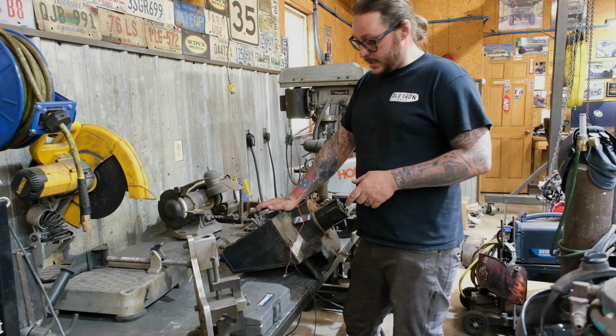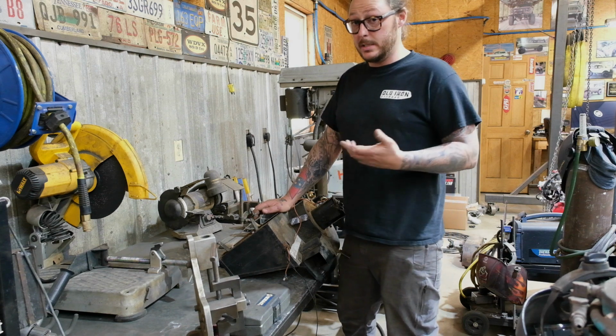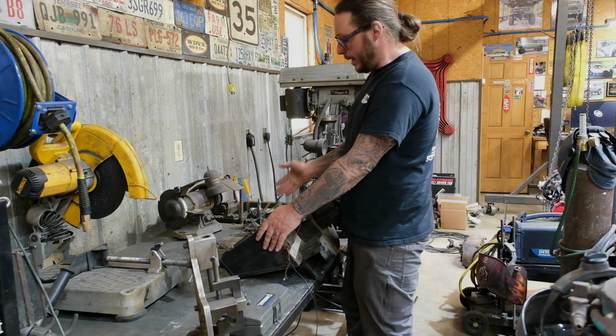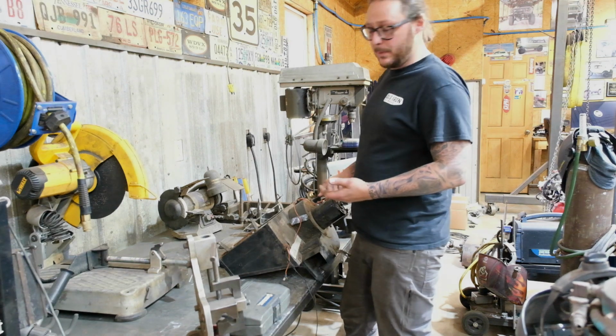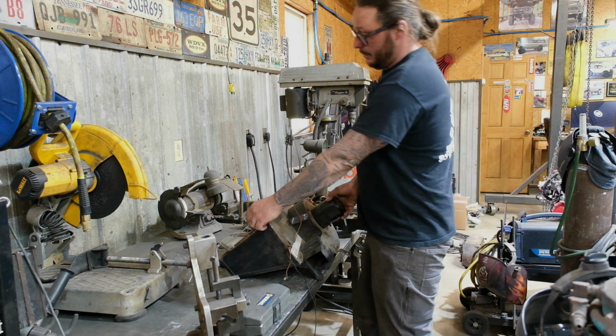Anyway, this has had ester oil in it. This is a functioning system, obviously. So there is some residual oil left in this evaporator. One of the things we're going to want to do is actually clean the inside of the evaporator itself, and then we're also going to clean the inside of the plenum.